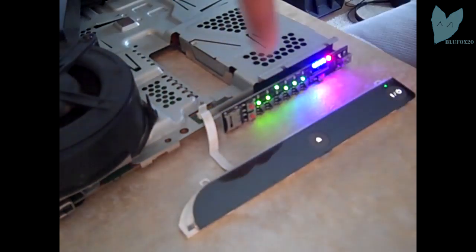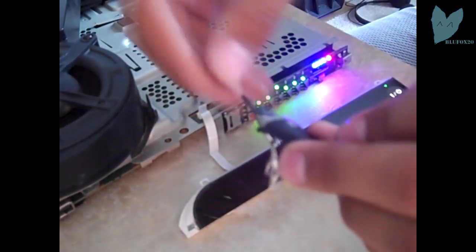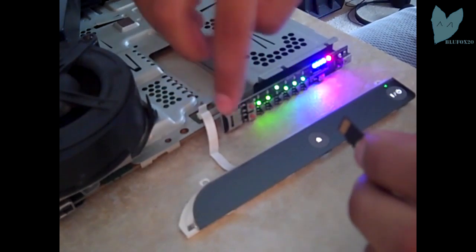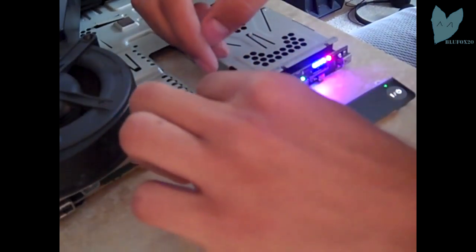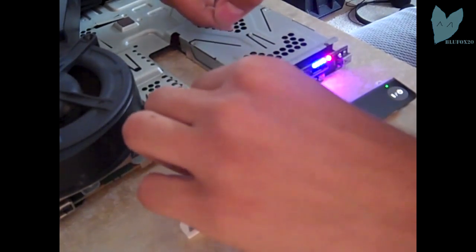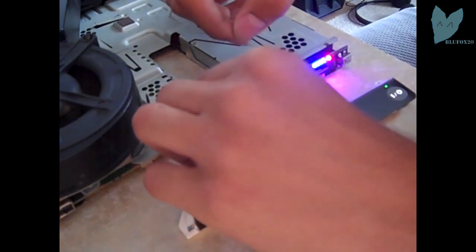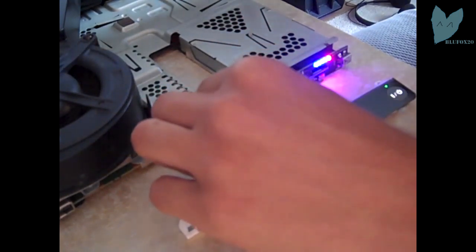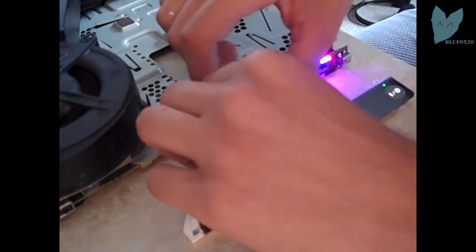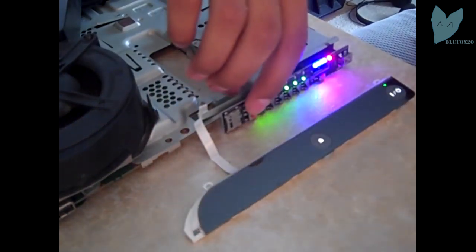Alright, so after you do that, you're going to want to empty your SD card and then put it back in the TF coverboard and put switches 1 and 2 down, 3 up, and the rest down. So all down besides switch 3 and you'll be good. Once you have the micro SD card in, just press start and wait for the backup process. It takes approximately 2 minutes per backup, and it makes 1 backup at a time with this update.